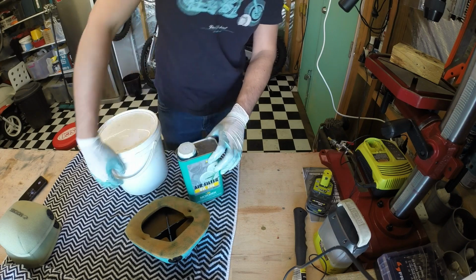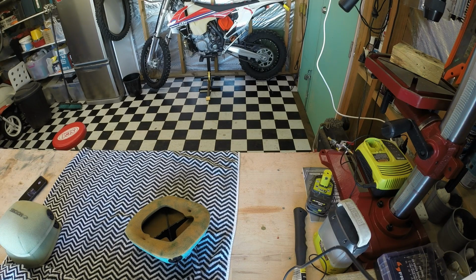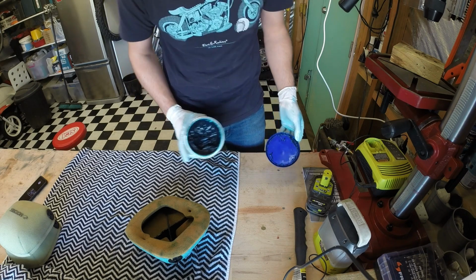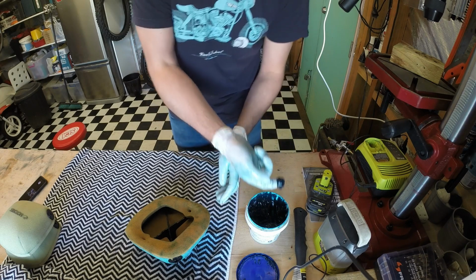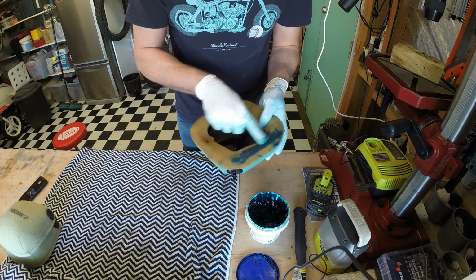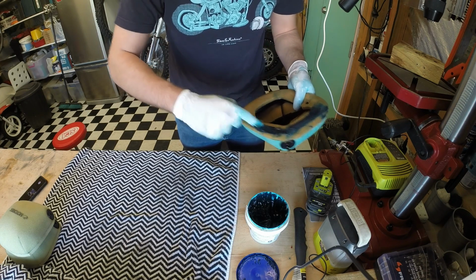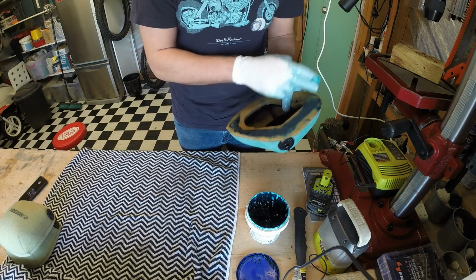Put the lid back on the filter oil this way. Okay, just got some grease. It's wheel bearing grease, but it's what I've got. Doesn't really matter. It's blue, so it matches the filter oil in colour. You don't need a great deal. You just spread it around. Just sort of try not to get any globs in the filter, because it's not too crash hot for your engine if you do that. Although it probably won't hurt anything, you might just foul a plug.